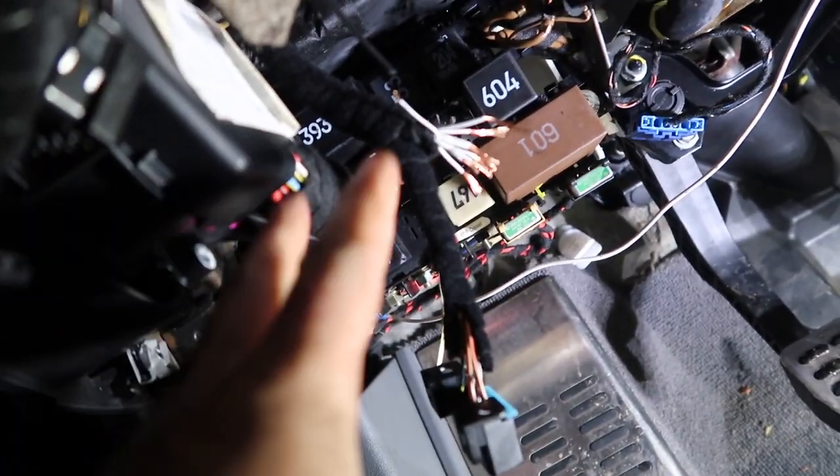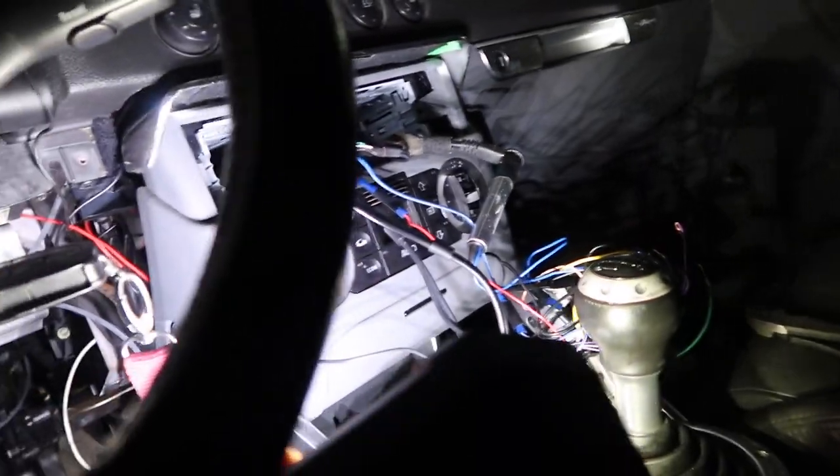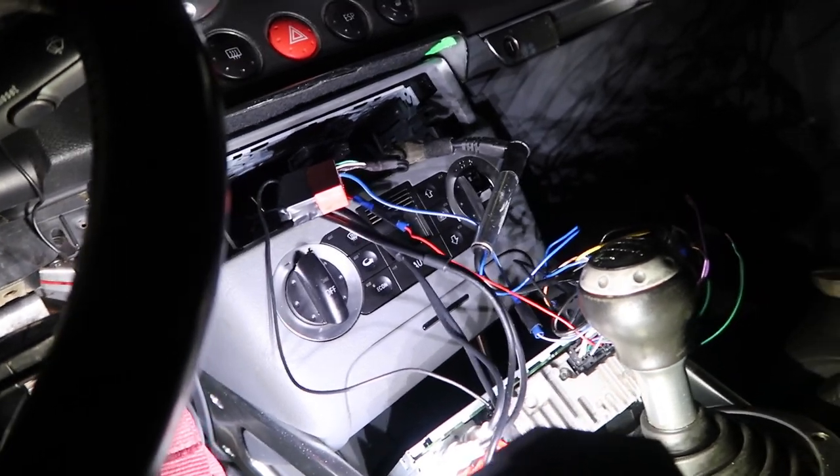Before I did this, I tried disconnecting the radio — you can't see it but the radio's sitting right there. Got the radio out and I've been checking the K-Line, trying to figure out if the K-Line was messed up behind the radio. It wasn't, so I've got something else messing with this K-Line. Radio's completely disconnected, and the K-Line's actually been cut up there behind the radio, but this is what I've done to fix what I have.